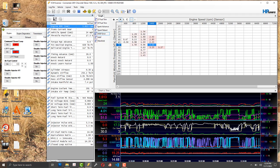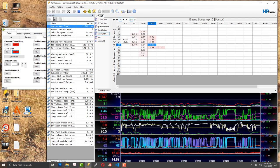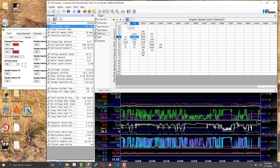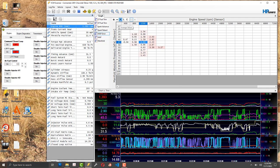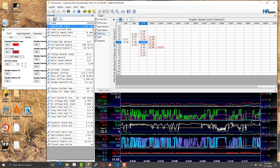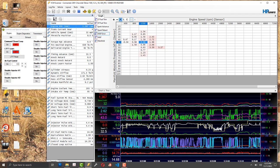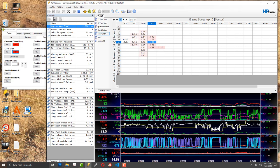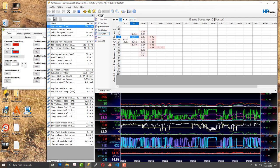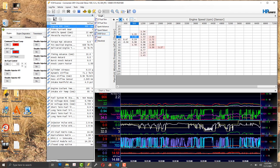Once you make a couple of changes I think it affects the whole row, and I'm well within five percent everywhere. You may get an outlier at like seven percent, but the cell hit count could be low. You don't want to sample too fast. When you configure the graphs you set the number of cell hits required before it displays a value — for the wideband I put 25, which my friend suggested.